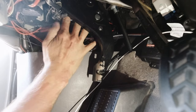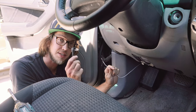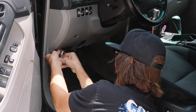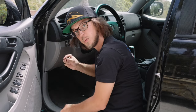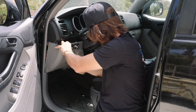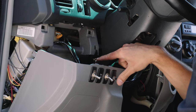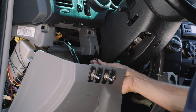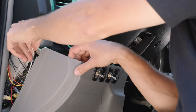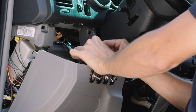We'll tuck this wiring away nice and clean, then we can hook up our ground. To hook up our ground and data cable, we'll need to take this panel off — it's pretty easy. We have two 10-millimeter bolts. Get those bolts out, give it a little tug, and it pops right out. Now with the panel off, grab yourself a 10-millimeter socket or wrench. There's a great ground location right here, real convenient in the dash. Run our ground wire around and up behind here, and it fits perfectly right onto that bolt.